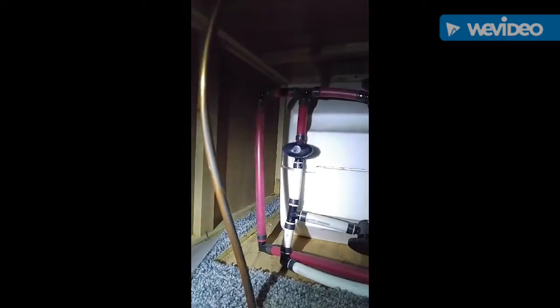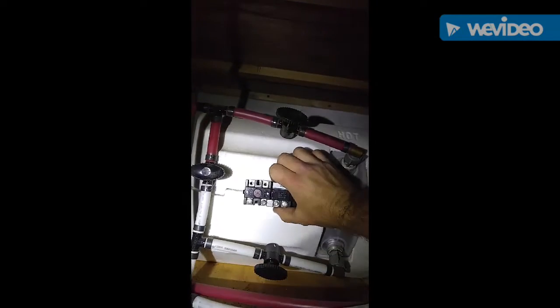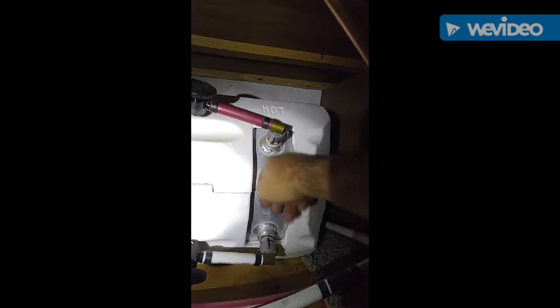Underneath my cabinetry, right next to my power inverter converter. Per the instructions it also says ideally put it on a flat surface. Well, the flat surfaces of my tank are tucked into the sides there, so that's not going to happen because I'm not removing any of my cabinet walls to install this. I'm going to remove a section of styrofoam right here and stick the thermostat to the side of the tank there. It's got some curvature to it, but if the thermostat's touching that tank it'll get plenty hot enough to read the temperature.